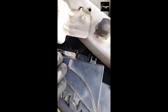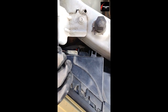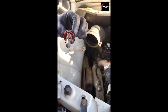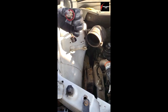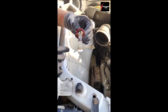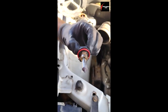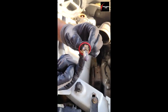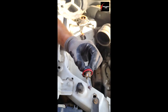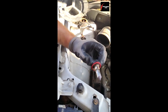Anything that is difficult to see I'll just show up above in a picture. Once you twist it — it's in this way — all you're doing is twisting it that much and pulling it straight out, because it's got little teeth in there that lock in. When it goes back in, it goes back in this way and you turn it to the right. The portion of the light bulb electrical plug will be pointed downwards — like if you look at a clock it'll be at six o'clock.